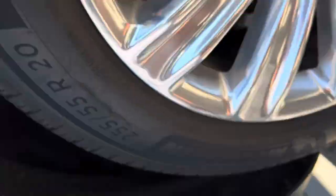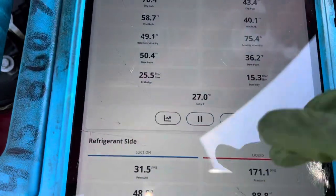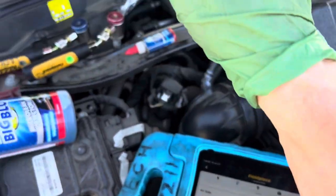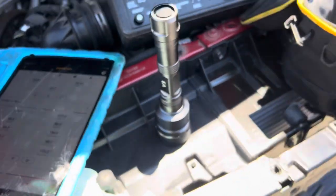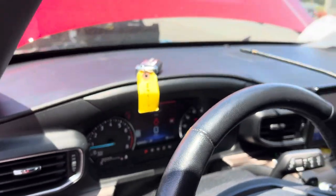You can see my sensor over there — let's check the superheat coming out of this rear evaporator. We're not taking the superheat of the front, we're taking the superheat of the back. Remember we're at 70 degrees outside, and we're getting 43 degrees coming out of the front dash vents. Our superheat for the rear is 13 degrees. Let's get the temperature for the rear.